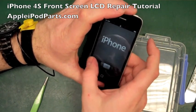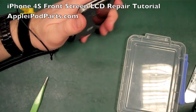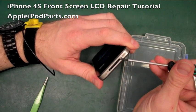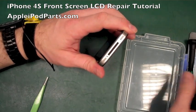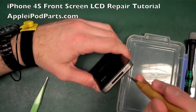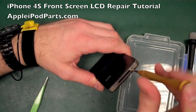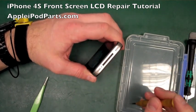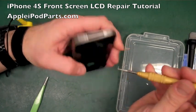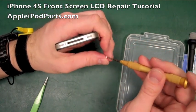One screen. So there we go, from start to finish. There's the iPhone 4S repair, the 2 screws going at the bottom. We need the pentalobe screwdriver for that, the Torx screwdriver. Again, my name's Neil Barker, thanks for watching my video for the 4S screen replacement. A little bit more fiddly than the iPhone 4, I'm sure you'll agree, but still, once you've done a few, there's nothing to stop you. You can get this repair down to probably 25 minutes or so, start to finish.